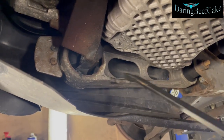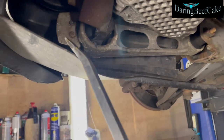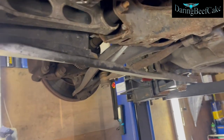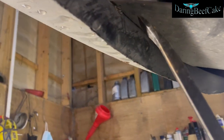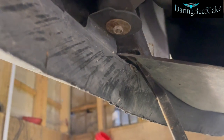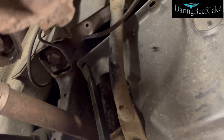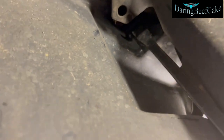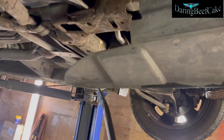In order to change these, I remove the front wheel to give me some space, and also this cover. I already loosened it — there's just a little clip here that goes into this hole. There's a 10mm screw or bolt holding it there, and then you're going to find another three 10mm bolts holding it. There's one hole there, another hole over there, and one more, so you have four 10mm bolts total plus the clip.